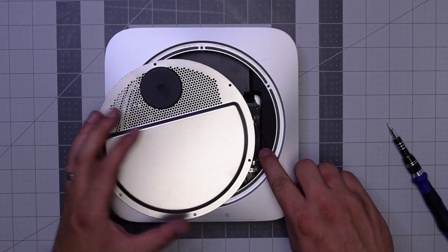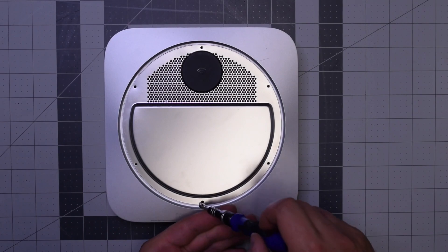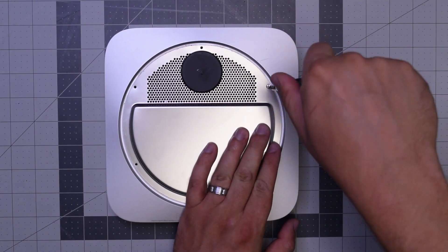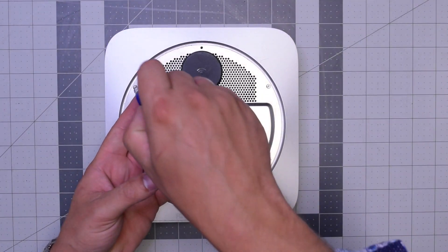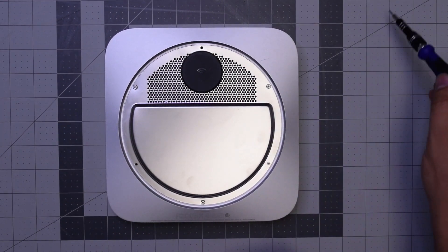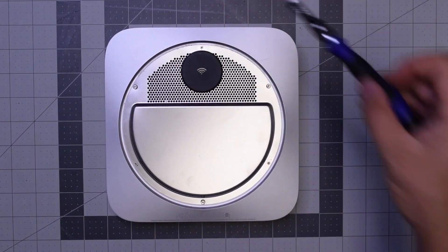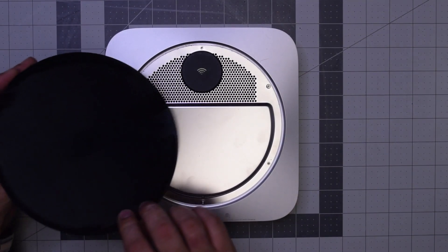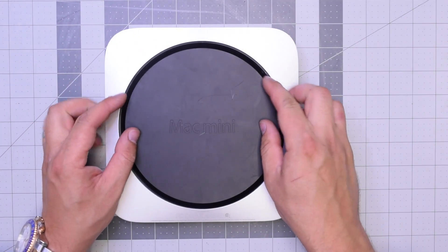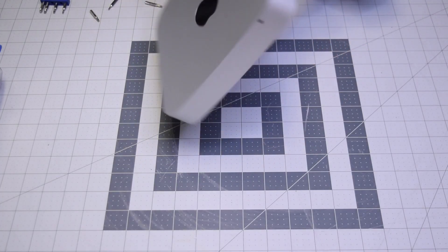Let's go ahead and tug that cable in a little bit. Align the Wi-Fi antenna cover and secure the three wider longer post TR6 screws first, then the other three smaller TR6 screws. With those connected, place back the cover — make sure to align the cover holes with the longer TR6 screws and then clip it into place. Now flip the unit back over and we're done.